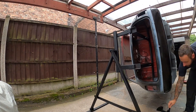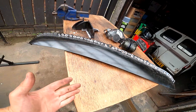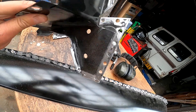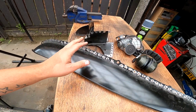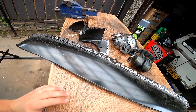I'm going to set you guys up and remove all these panels, get trimmed up, tidied up, prepped up, painted and ready to go. Out here at the makeshift workbench - I've drilled all my holes and cleaned the thing back. I'm just going to put some zinc primer on this side so the mating face still has primer. These are all prepped up and going to get plug welded and stitch welded on. I need to get it all mocked up again, weld the closers, take the valance back off, weld these properly, then pop the valance back on - it needs to line up with the subframe holes.